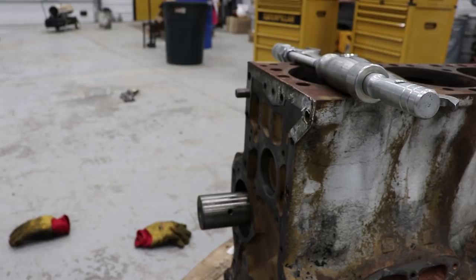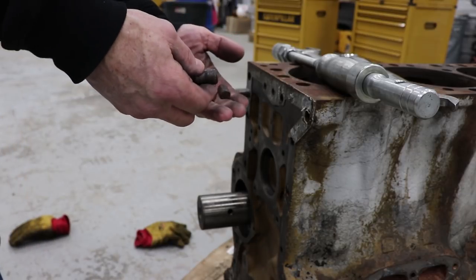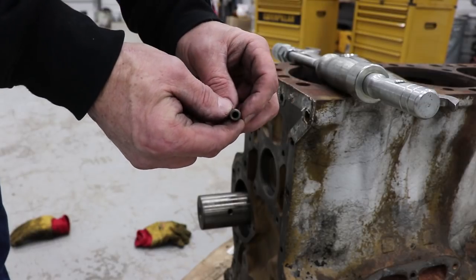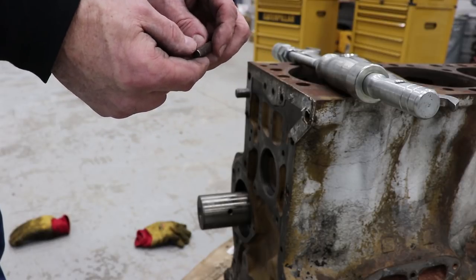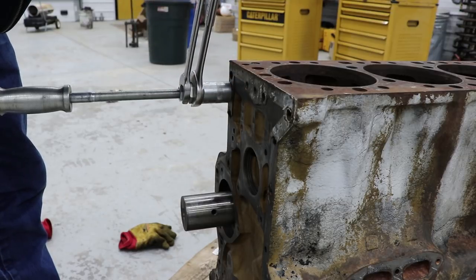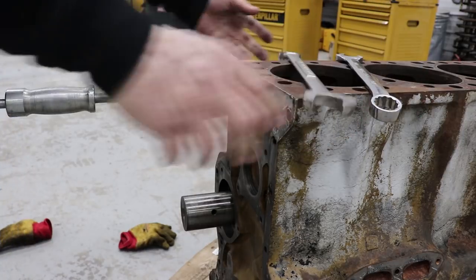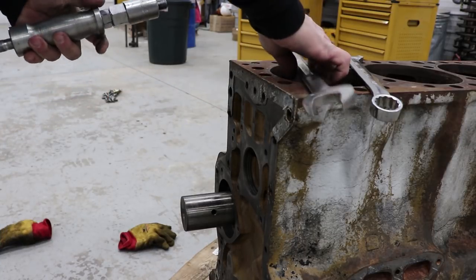If you're going to work on 1693 engines, one of the tools you need is a dowel puller. These two are out of the front cover, this one's out of the front of the block and guides the spacer plate down, and this one is in the back. Believe it or not, this small hole is the main oil supply for both camshafts. They've got to come out of the deck because the deck's got to get milled. I'm pulling them out of the back and front everywhere for a reason — and I'll show you. Pulls them right out, piece of cake. Don't know how I lived without this.